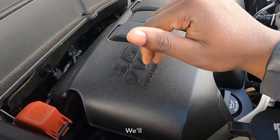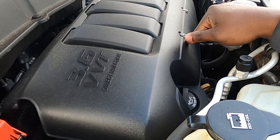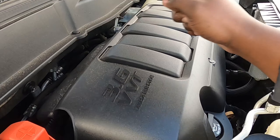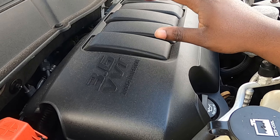This is a front-wheel layout engine even though it's all-wheel drive. Bank two is on the front side and bank one is on the other side. In layman's terms, the code means the car doesn't like what the oxygen sensor is sensing past the catalytic converter.